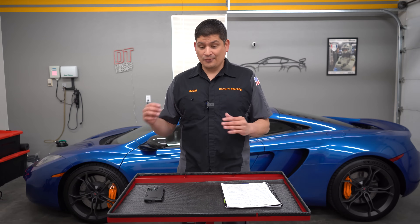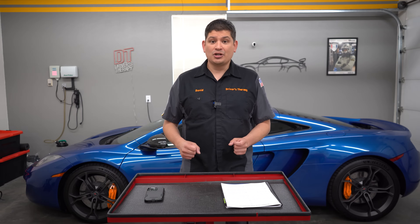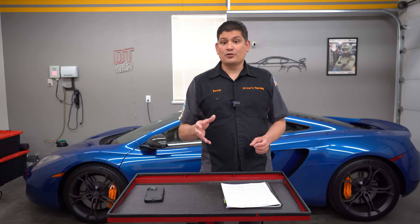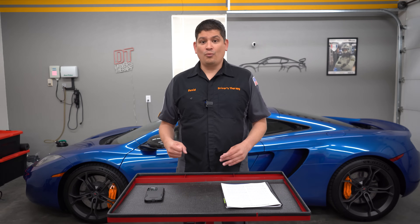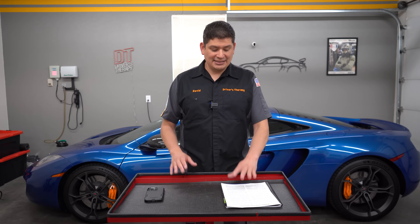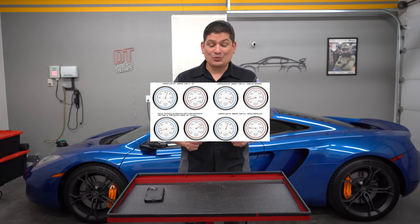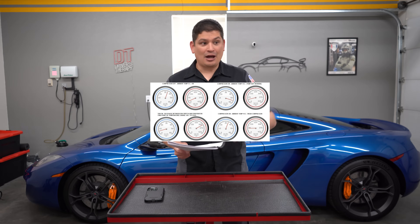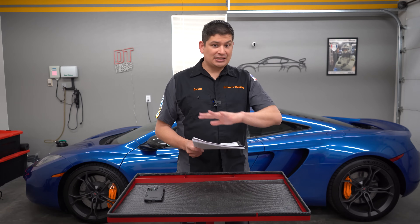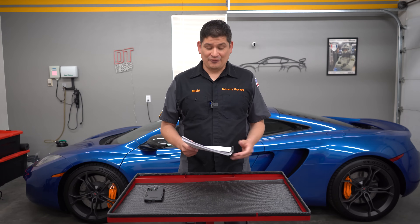You really need to know how the AC system works. You need to know about the receiver, the condenser, the evaporator, and the compressor. You need to know what happens when there's too much air gap in the compressor clutch, what happens when the shaft seal fails on the compressor. You need to know about UV dye — how it's helpful, how you insert it, and what it means if you see dye in certain areas. The AC system is a little complex if you don't have much history, but this is where MotorAge is really going to help you. As you learn about it, you start to understand things at home too, since AC systems are pretty much the same concept across the board.